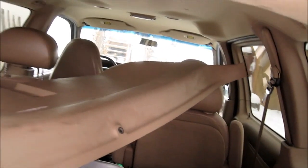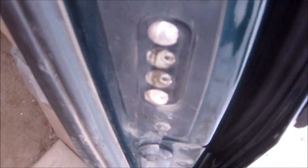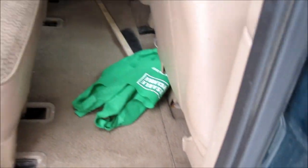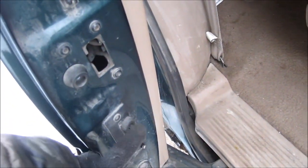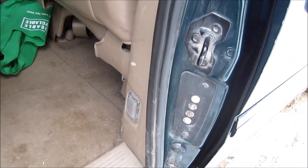I had trouble with the side door a couple years ago — it was so cold that the contacts weren't making contact on this side and this side here. So what I did was open this up and put the wires together, so no matter what you do with the side door, the buzzer doesn't work or the lights. I've cleaned these pins so many times, but it had to do with the rubber — it was 38 to 40 below and the rubbers were so stiff they were definitely not making contact one cold day, no matter how many times I slammed the door.